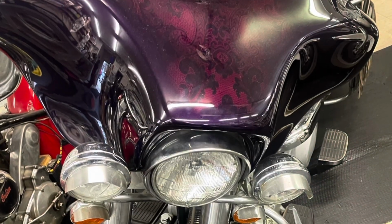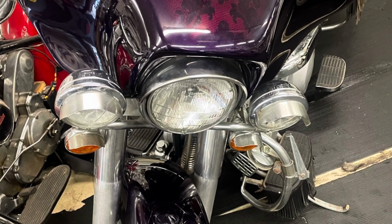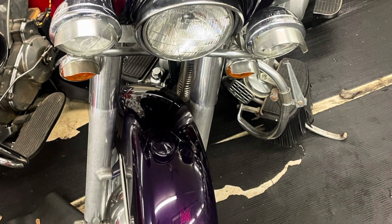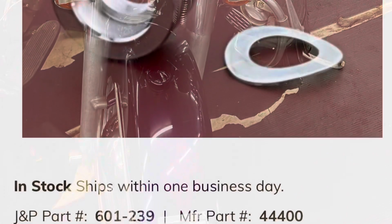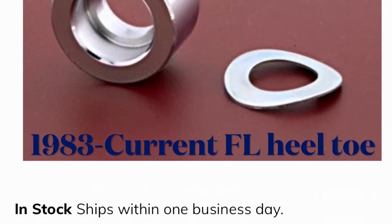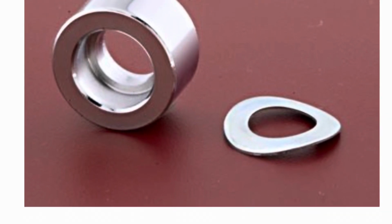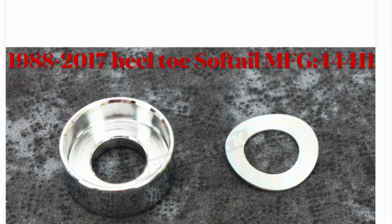I would personally recommend an inner primary bearing kit, main shaft seal, and also getting a new clutch plate kit that you might as well do while you've got it open and while you're in there, so you don't have to open it again. If you replaced all the following items and still feel like it's rattling or you can hear a rattle down the road, the best thing you can do is a Stevenson Cycle anti-rattle kit. And if you're in Detroit or a suburb, they're a great shop to get service or any part Harley wise.